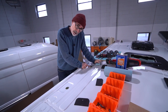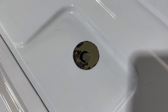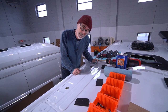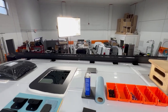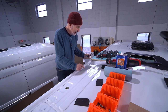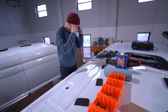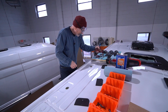When you remove the little weather cap, you'll notice there's a hole in the roof and a threaded insert — it's like a plus nut. The hole in the roof and the threaded insert don't always line up. The whole driver's side lined up perfectly, but on this side the first two I opened — no good. I've got to file away some of the hole, elongate these holes. This one is even worse. I find that to be totally unacceptable — I don't understand that one bit.